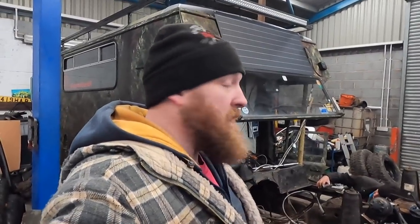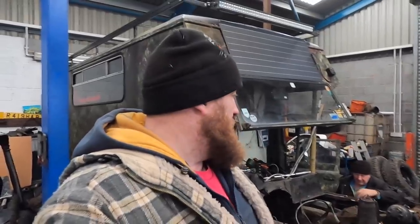Fairly drastic, but it needs doing. What we're doing now — there's no end of old fuel lines for the old petrol V8, brackets, fuel pumps, old wiring that's now redundant. All that needs to be stripped off. Once that's done you can see where everything's going, and we can start lifting the new bulkhead in and reattaching all the new parts. We also need to make a list of everything we need to order — like a new heater box. As we've dug into it, it's not just the motor — the whole thing's kind of knackered. So just replace as we go.